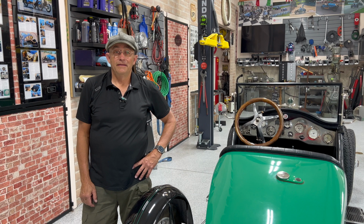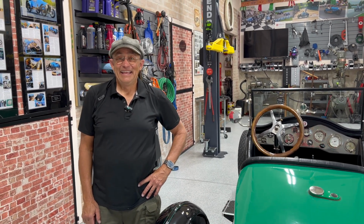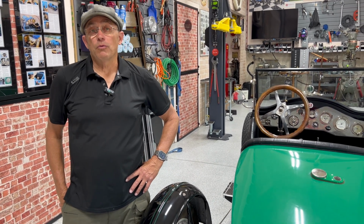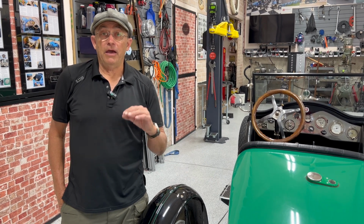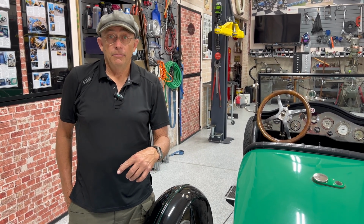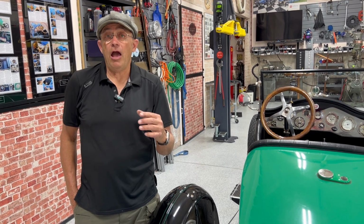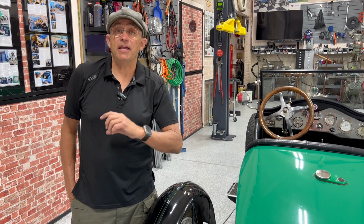Interesting. I'm just getting my brain around all that. So in the wet, you might want to rely on your inner brake more. But you've got asbestos on both sides, and asbestos is the best material in the world for braking. Not for breathing, maybe, but for braking. No matter how much oil or water gets on asbestos, it clamps the same way.